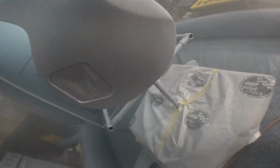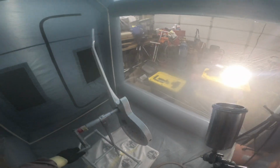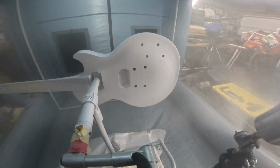So we're watching one of my subsequent coats of flake here. I think this is the third or fourth coat. I ended up doing 4 coats in total to get the coverage that I was comfortable with. And when you're doing that many coats of any kind of product, automotive-wise, you really need to watch your flash times. Flash times being the time that you wait between coats.